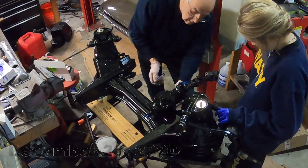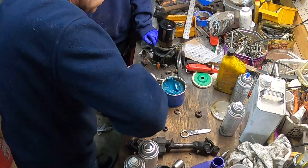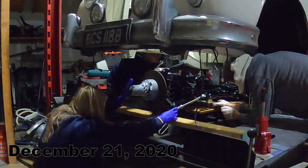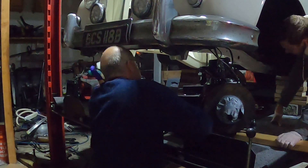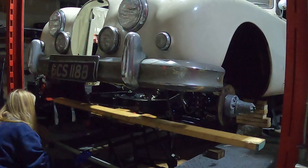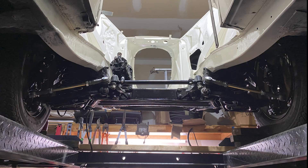All of the steering joints in the steering box were reconditioned and reassembled. The steering geometry was loosely put together, as this would be adjusted once everything was back into the car. Like the removal, the installation of the reconditioned subframe was another multi-person job that involved positioning the suspension under the car and then lowering the car into the subframe. Once complete, the front subframe looked fantastic.